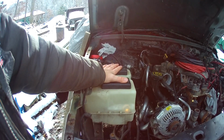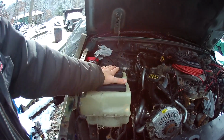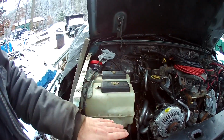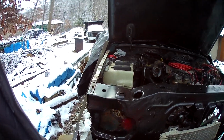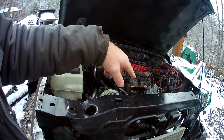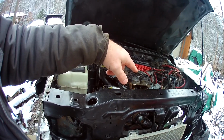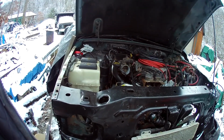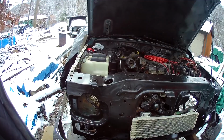But I don't see any reason why I can't research doing something different with these and the electric power steering pump later. I'll leave myself with provisions. I'm converting the -6AN on the factory pump, so it'll just be a matter of making up a different pressure and return line, get them fitted, and it'll be fine.